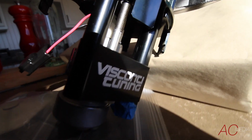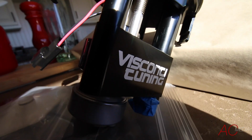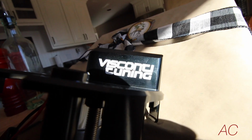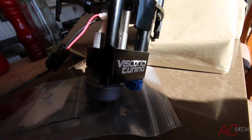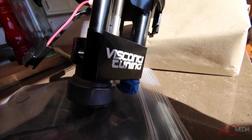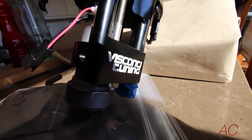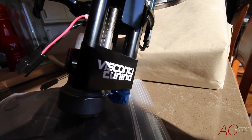So with this product right here, we're literally going to make probably 600 horsepower at around 30 pounds of boost. That's the plan. On my turbo, I've seen those numbers pretty consistently over the community and from people I know personally. Generally on a 3582R, with about 28 to 30 pounds, you get 600 wheel. No issues.